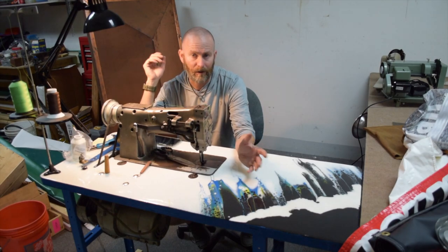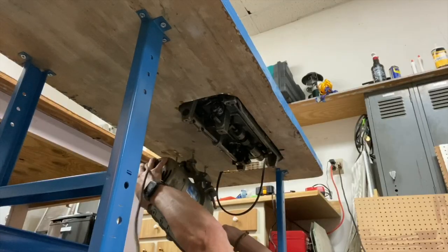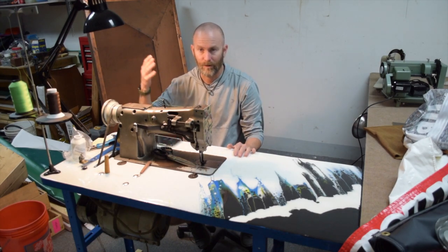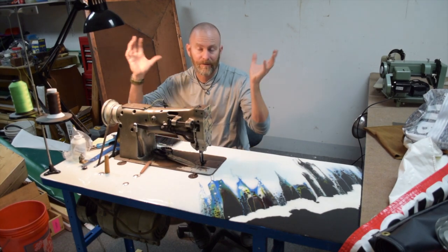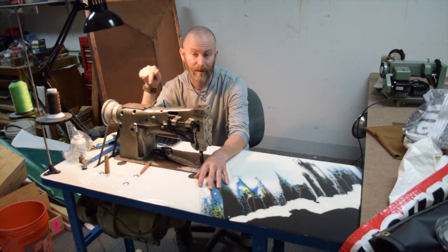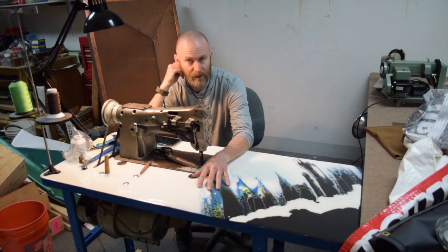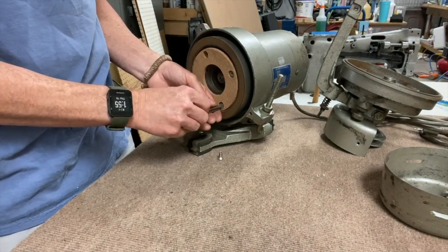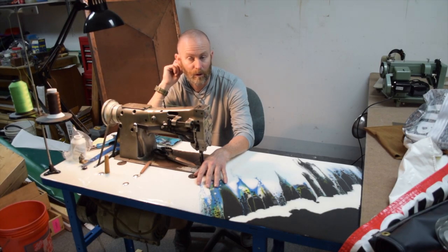After I poured the glaze coat and let it dry for 72 hours, I was able to reassemble the machine to the table. Probably the hardest part of that was hanging the motor. There's probably a smarter way to do it, like putting the motor on with the tabletop upside down on another table or something. But I'm not that smart, so I held it over my face while trying to hang it up and almost dropped it onto my face. If you're working by yourself with this stuff, that motor probably weighs 70 pounds — definitely use caution, don't be dumb like me. I did put a new clutch in my clutch motor, and it feels significantly better. It's the first time I've used a clutch motor with a brand new clutch in it, and it definitely runs really well now.